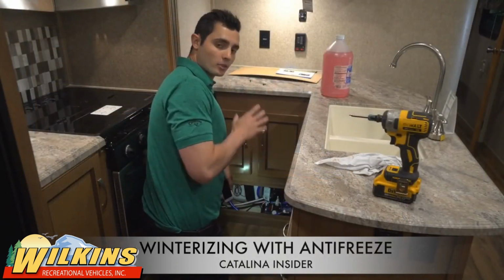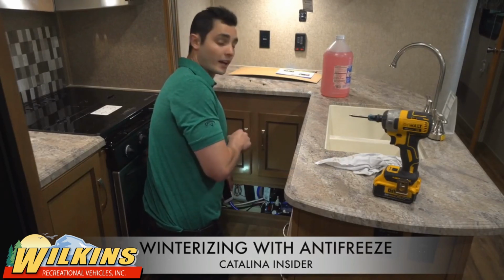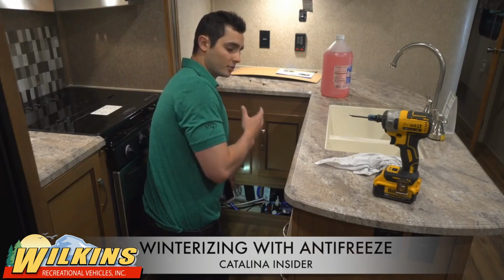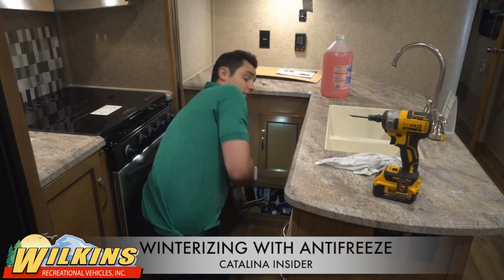So the first step after locating your water heater and water pump on our floor plan guide on our website is to remove the access panel. Once you have the access panel removed, pull the winterization hose out so that you can use it. That's this guy right here.